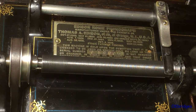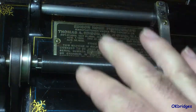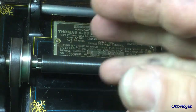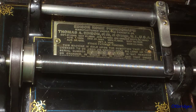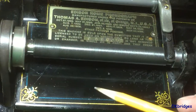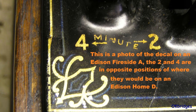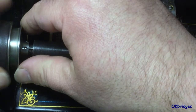It's very important that you check a machine — if you cannot get the clutch to shift over and you have a Model D machine, some of the later models became four minute only where it was permanently blocked in the four minute position and you could not shift it back and forth. You can't really see it except as a little ghost mark here, but there are the remnants of a little gold decal that used to be here that says 'minute' with an arrow pointing at a four and an arrow pointing at a two, to tell you which way to move the clutch casing in or out to play either a two minute record or a four minute record.